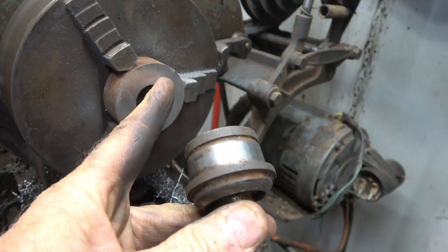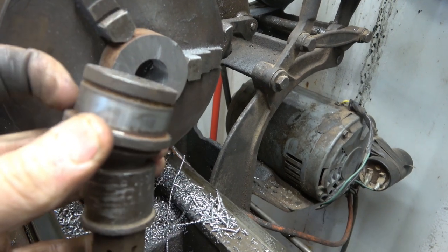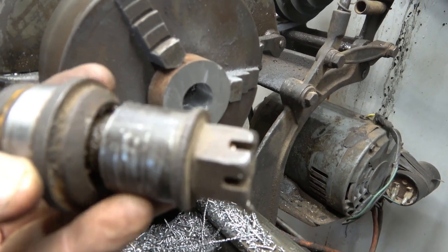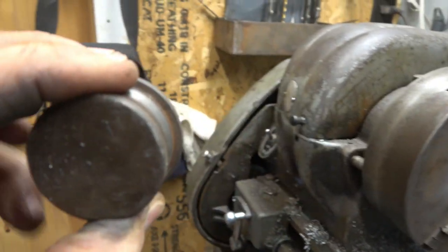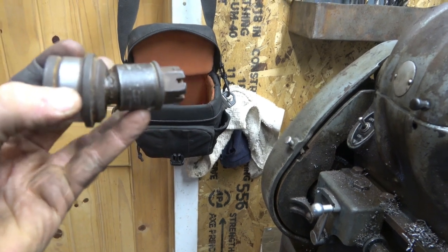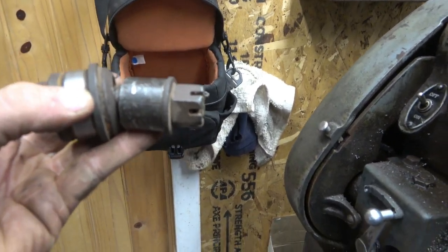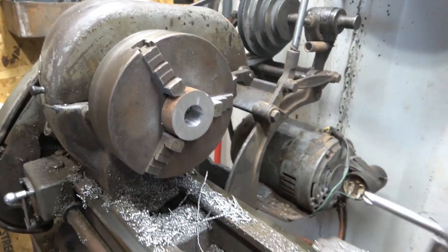So what I'm doing is I'm cutting all this out of here, fitting this so it's tight against here, and then this part's going to attach to the swing arm, and then that part of the ball joint with the nut on it, this is a loose ball joint. I took it off a Ford Ranger, but that's the ball joint I'm going to use because it's small enough and heavy duty enough for what I feel I need. So it's kind of going to run like this. This part I'm holding onto the swing arm, and then this part right here is going to be mounted to the frame. So it's kind of going to be like a push against the ball joint, just how it's mounted on your car, so that all the force is from the top that way. So as I go, you'll see what I'm going to do. But anyway, right now, I'm cutting my parts and letting you in a little bit on this.